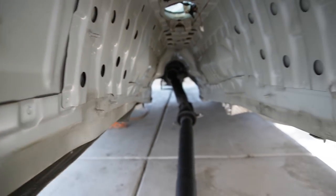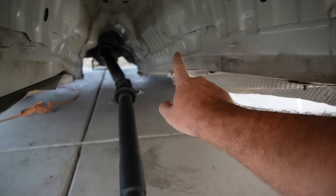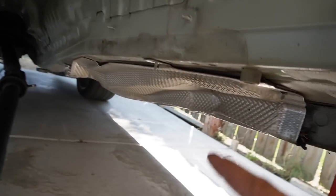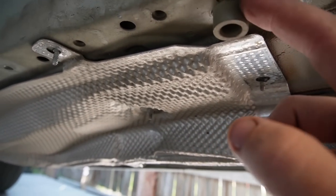Here's the all-wheel drive one, and here's the rear-wheel drive one — nothing sticks out on this side, but on that side there's this seam-welded piece we can cut and drill out as far back as possible. I need to figure out how to cut this without ruining the car's structural integrity since there's a mounting point right there. I'm going to call it a day and do research before proceeding. Once we sort the transmission tunnel situation and get it onto the wagon, we can assemble the engine bay, drop in the engine and transmission, and hopefully at least get it starting and moving.